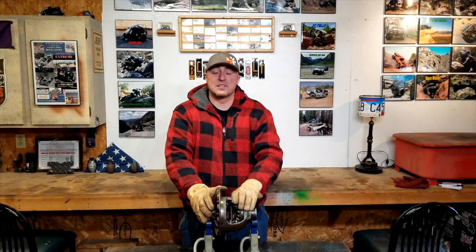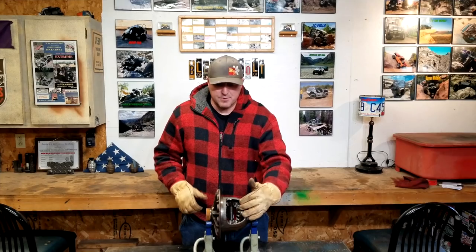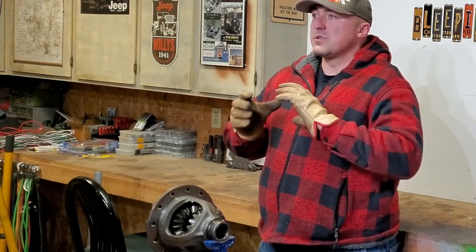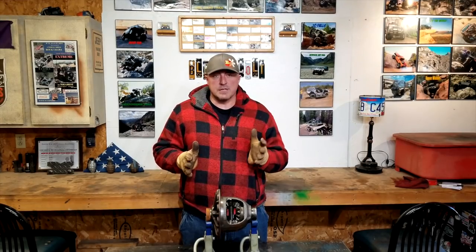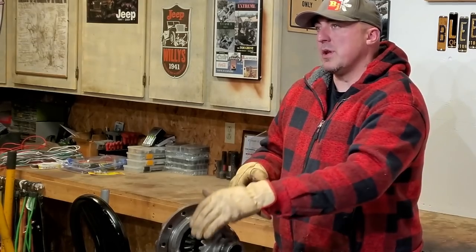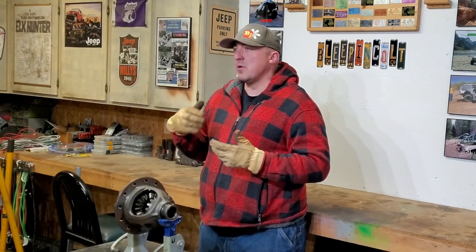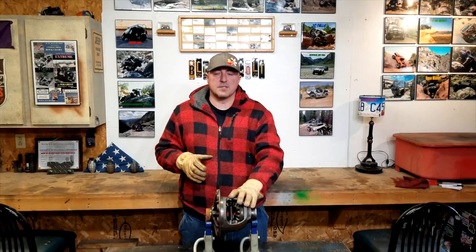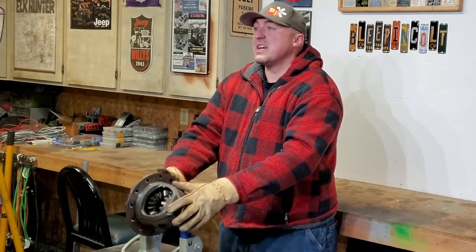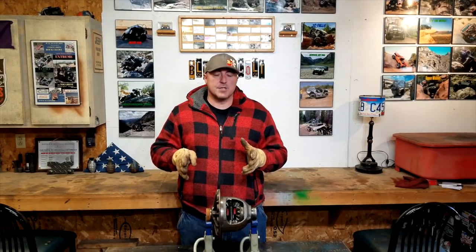There are a couple quick things I want to go over before we weld this thing up and make our orb of traction, or what's more commonly known as the Lincoln Locker. First thing: these are your side gears and these are your spider gears. You have two side gears that go on the sides of your axle where your axle shafts connect, and then your spider gears on the top and bottom where your center pin goes through. Those turn inside your differential when you're taking a corner — your inside tire is gonna have less rotations than your outside tire, and what this does is allows that to happen without any binding. When we weld this up, or if you put in a spool or a heavy actuating locker like a Detroit, what happens is when you take that corner one of those tires is either gonna spin or drag and it's gonna make that barking sound. When you hear a vehicle take a corner that has a solid locked rear end — that's the noise you get because your tires are no longer working separate of each other, they're working together as one solid unit.